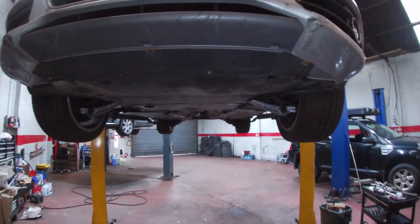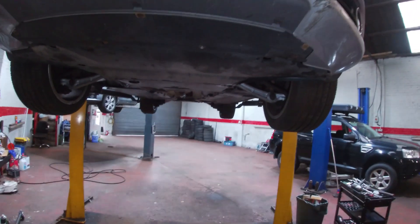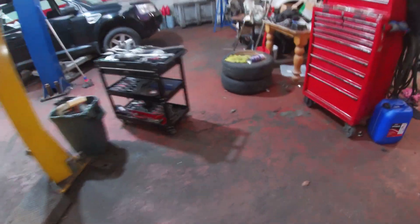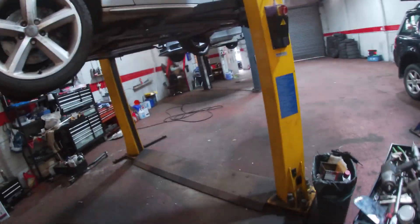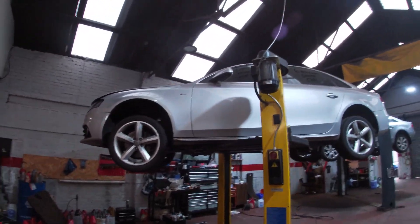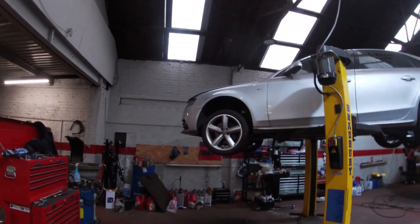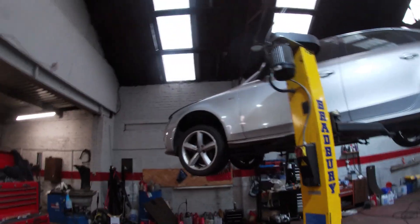We had a lot of air trapped between basically the ABS pump and the master cylinder. Although we were getting fluid at all the brake nipples, we were not getting anywhere. Thankfully it eventually came good, though I did lose my patience — that's the remnants of a bin, and it may have taken the brunt of my frustrations. But it's fixed now. Moving on — we did the timing belt as well. That big blue box up there has all the timing tools in it. Put it all on, started up — instant, boom, brilliant. However, we had a flashing glow plug light, so I decided to take it apart again to check it. Lo and behold, it slipped again. I put it down to a faulty tensioner, sent it back, got another one, did the exact same thing, and it's all good now.